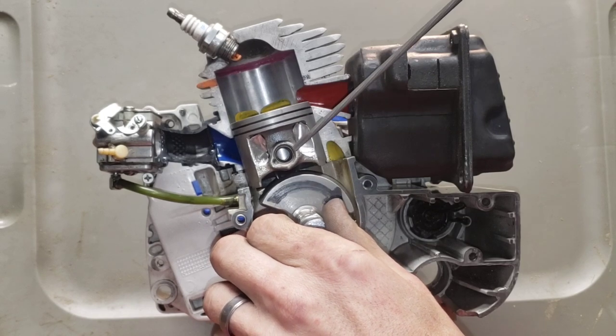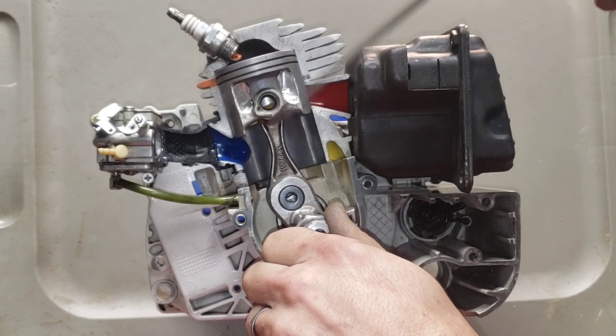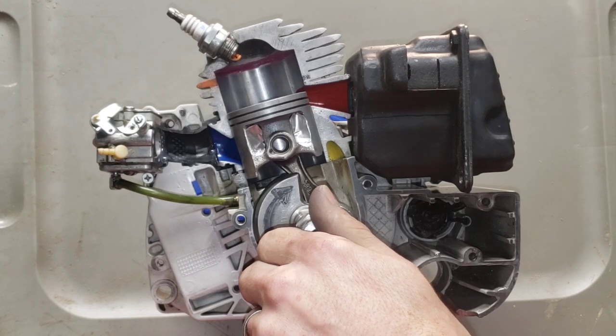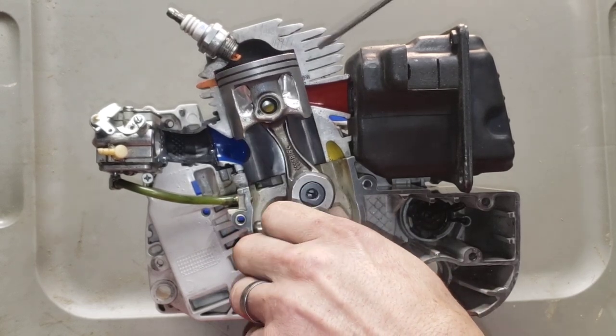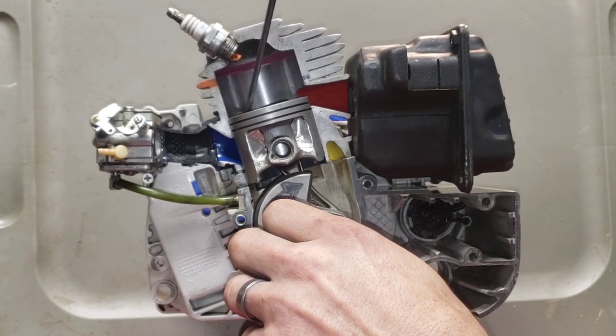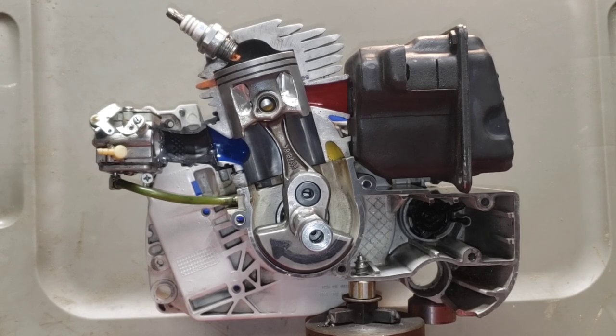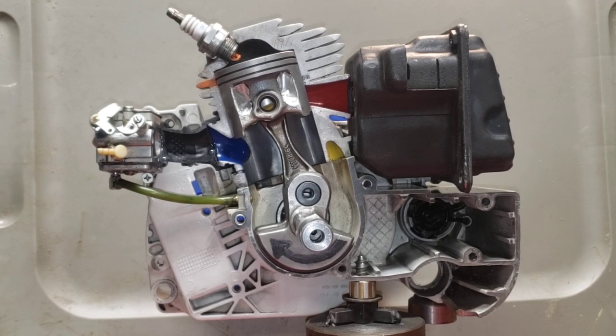I'm here to make this as simple as possible. On the upstroke you are creating a vacuum; on the downstroke, positive pressure. That's running your impulse line, operating the fuel pump diaphragm in the carb. Piston going up draws in the fuel; going down squeezes the charge through your uppers. That's the gist of it — suck, squeeze, bang, blow. It's harder to explain simply than you'd think because there's a lot going on at once. At 12,000 RPMs that's 200 times a second the piston is blasting up and down — pretty wild.